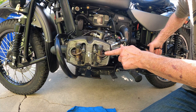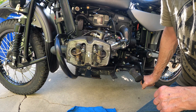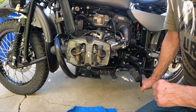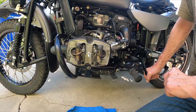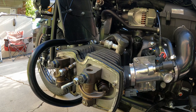The only top dead center we care about is the compression cycle — when the spark plug goes boom. So if you look at this as I rotate: you can see this closes. Okay, that was top dead center — there's slack there, you could actually adjust both valves right now. Keep turning and you'll see the exhaust valve open as the piston comes up, pushing all the burnt gas out of the cylinder. As it gets to the top dead center we don't want, the intake valve is going to open. Now the piston is sucking fresh air and gas into the chamber, and once that valve closes again, now you can adjust them.